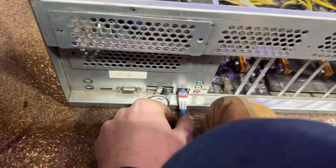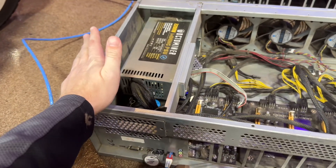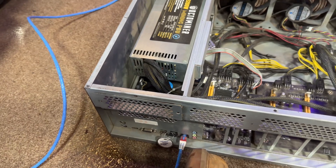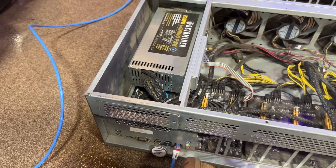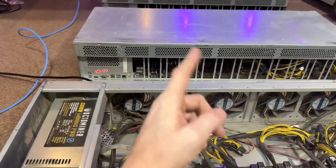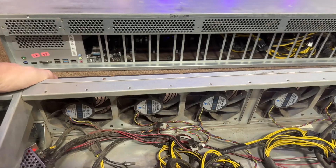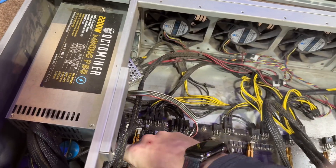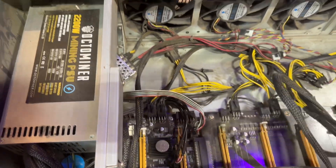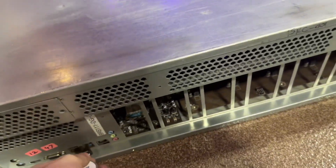No activity so far. I did swap the RAM from one channel to another — not sure if the RAM's even good. It could be low voltage on the PSU; the fans do work just fine so I'm inclined to believe the PSU is okay. I'm going to try swapping RAM over to see if the RAM is bad, but I think there's an issue with the board because when I turn on the power supply it doesn't automatically power on. I'm going to pull the coin cell to make sure the BIOS fully resets. I also found the mSATA just clanking around inside — I'm sure that's good for it. Let's move on to the much cleaner-looking case number two.